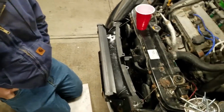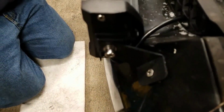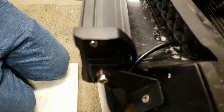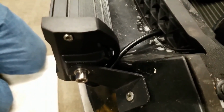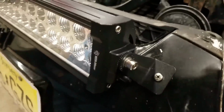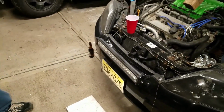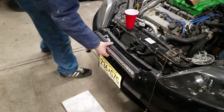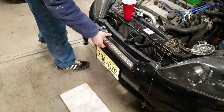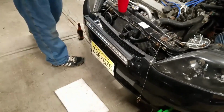It's already there. Just so you know, the shorter Allen key heads go right in here, and then on there is a lock washer and a normal washer. There they are, and they snug up quite nicely, so that you can do a slight adjustment to the LED. You want to move the LED up and down so you can adjust them in the meantime before you crank them down to get the aim right, and then you can really snug those puppies up.